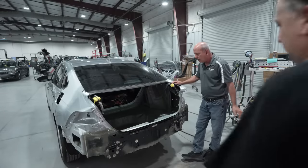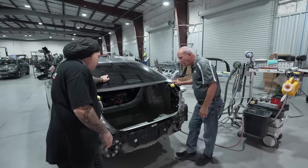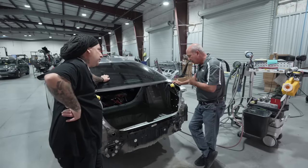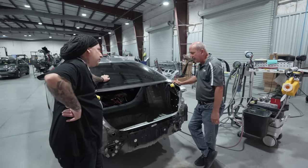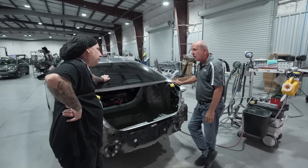All right, what do you think? How it looks all cut in? It looks factory. I think it came out nice. The 100 MPT tintable waterborne sealer, direct to metal. It works great for this application. And trunk floors, radiator support. You were saying that you can use your old base.